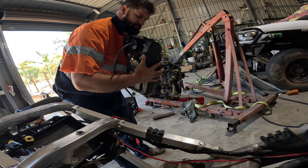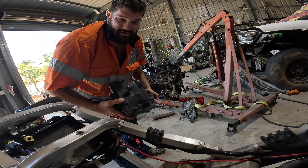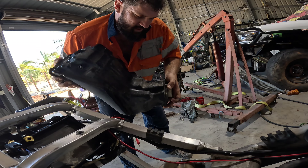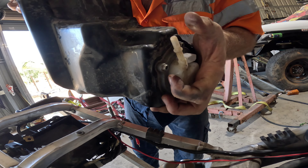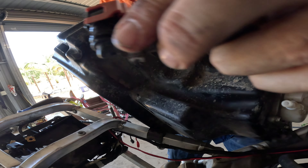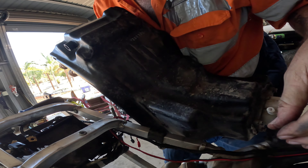Full of fuel so I can't put it down. Now I'm going to take the subframe off next and then fit the new one in. That's pretty much how you take the fuel tank off - that little black clip at the front there that I took off, and then you just squeeze the two clips together. Squeeze them both either side and then it just pops straight off.